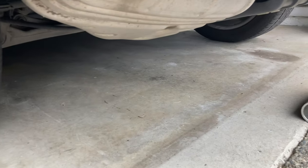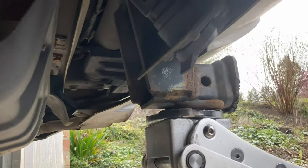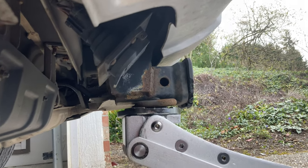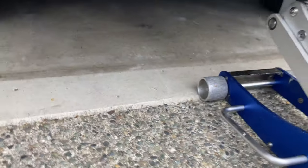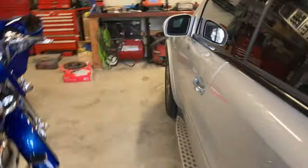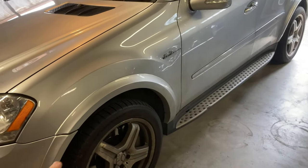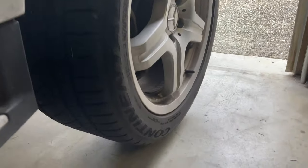Special shout out to Sam AMG — I was curious whether the air suspension requires any special lifting technique. Sounds like it's pretty straightforward: for the rear, if you have the factory tow hitch like I do, you can lift from there. Otherwise you can lift from the factory diff. Up front there's a mounting block under the engine, just like other Mercedes. I just wanted to double-check because some air suspension cars require a certain technique.